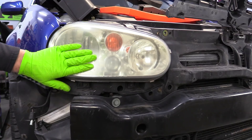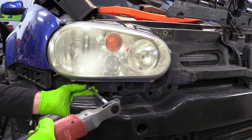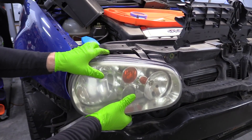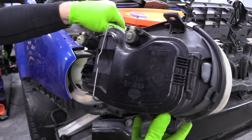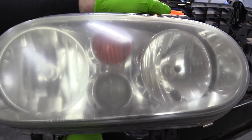It is time to remove our old headlights. It's held in with four screws — we got two at the bottom, two at the top. Now we can slide our headlight forward, reach behind it, and disconnect it. You can see here's our factory headlight. Say goodbye to this old girl.